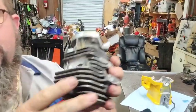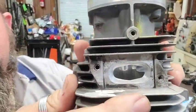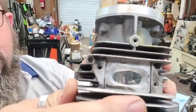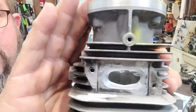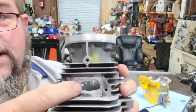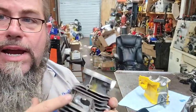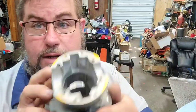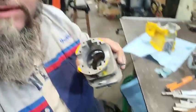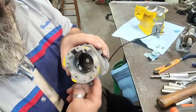Okie dokie. Now, see how I got that hard lip out of there? Now, if you're looking about doing this, I did not grind that lip all the way out to the porthole. If you look inside the port, there's a chamfered hole inside the port. So when I grind, I look down in here.